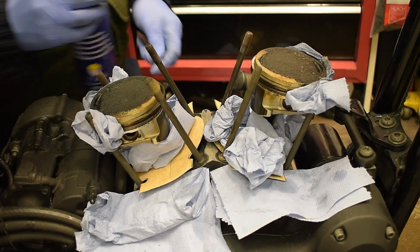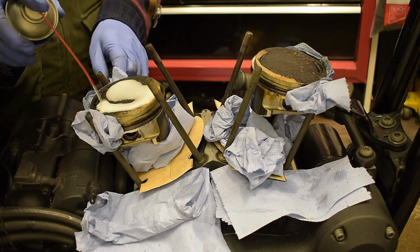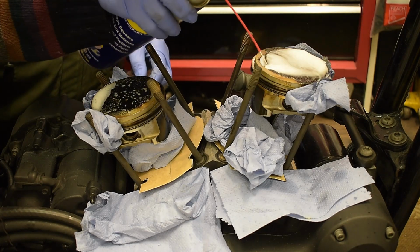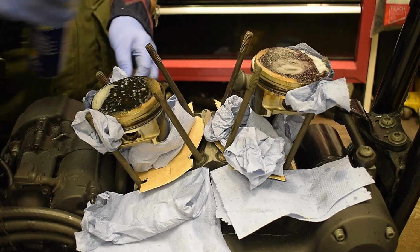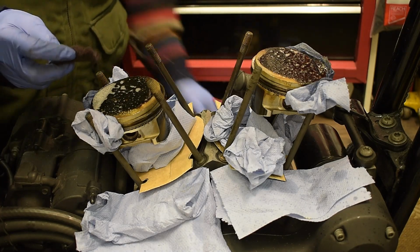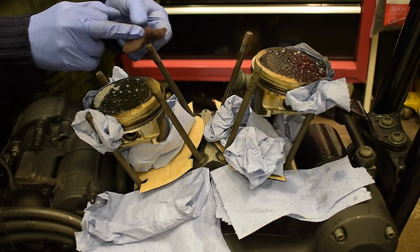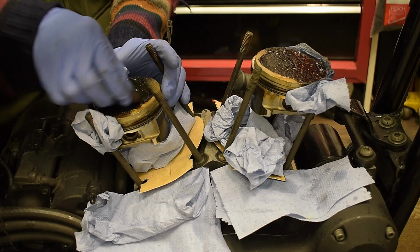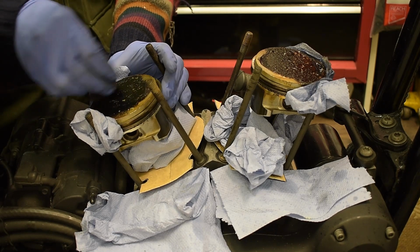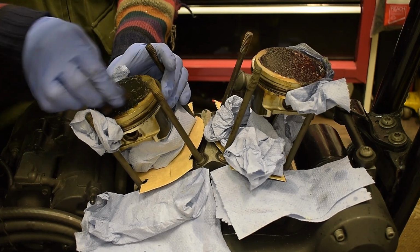So I've been looking on YouTube and Googling various ways of cleaning gasket surfaces, and I'm getting quite a few conflicting bits of information. It seems WD-40 is quite good for removing these carbon deposits, but Scotch Brite, I've heard several things. One site said that it's got aluminium oxide or titanium oxide embedded in it, and that can get in the cranks and all that. It's quite an abrasive material apparently, so not a good idea to get that anywhere near the gasket surfaces.